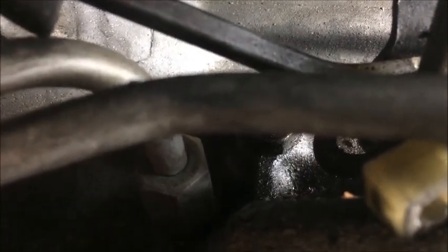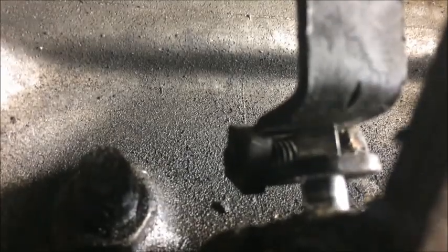Alright, yeah, so the kickdown lever is loose, but it's not being super cooperative. So I'm going to have to get in there with either a screwdriver or a little bit of a pry bar, get underneath it and put some pressure under it. I just want to pry it away from the other piece of linkage below it, and hopefully not damage it in the process. The two of them are attached not to the same part of the same shaft, but to a similar part. You can see it's moved up slightly there because it works sort of like a wedge. I've got to get underneath it so I get it to come off of that shaft.